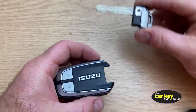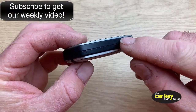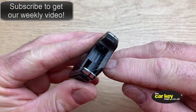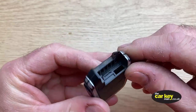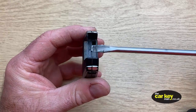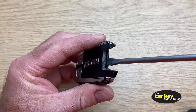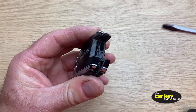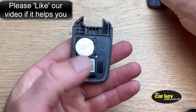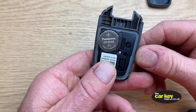The key splits into two halves, as you can see all the way around. To do that, there's a little slot here — just put your finger in there. It just needs something in there, so we're going to use a little flathead screwdriver. Put it into the gap, give it a little twist — really easy — and the key comes open. The key battery is a CR2032.